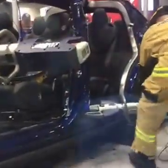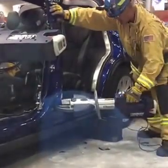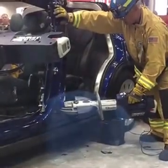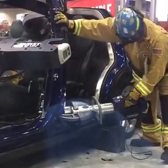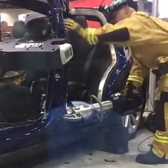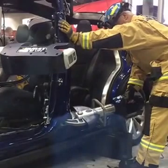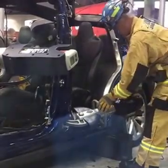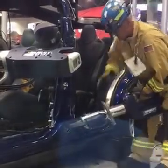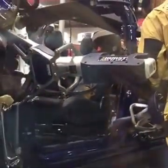Two cuts left. Larry's going to make a cut on the back side of that lower B-pillar, then move to the front. Down here we don't have the boron but we do have the dual-phase steel. That completes our total sidewall removal on the Tesla Model X.